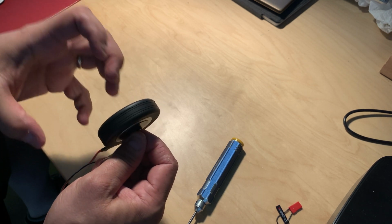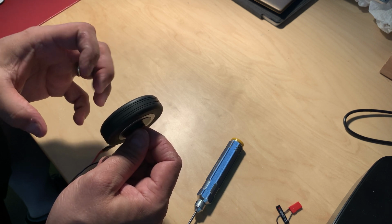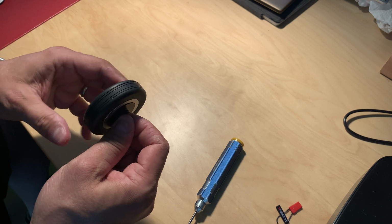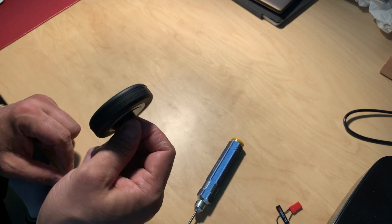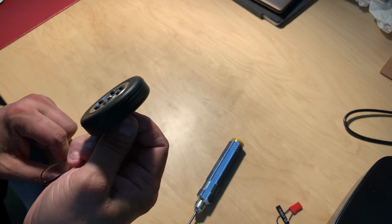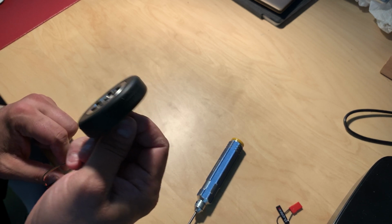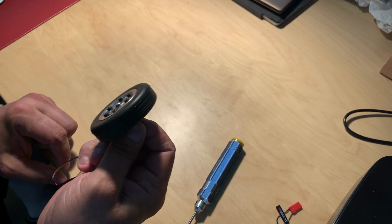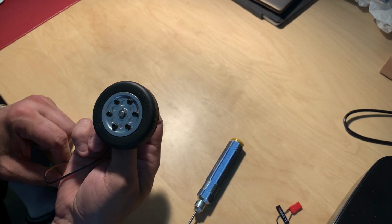And now what will happen is that brake plate will just float in there, and if you just apply a little bit of braking, it doesn't have to overcome the magnets, and you will get really good proportional braking out of these JP brakes, even though the manufacturer says they're not proportional. They actually are proportional. The controller is proportional, and they work really well if you take these magnets out. All right, hope this was helpful.